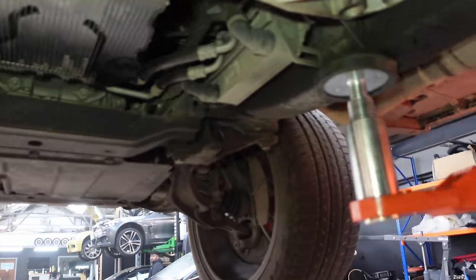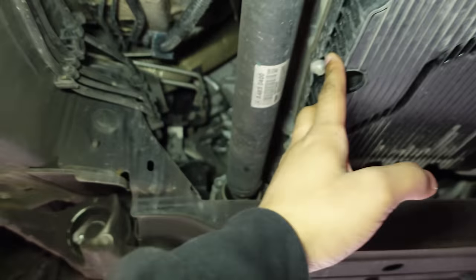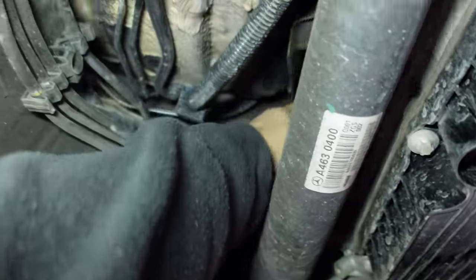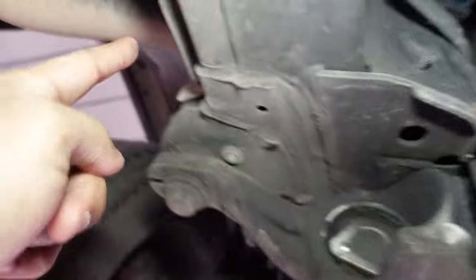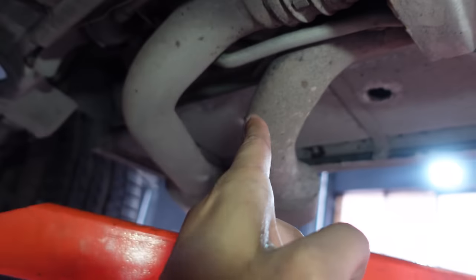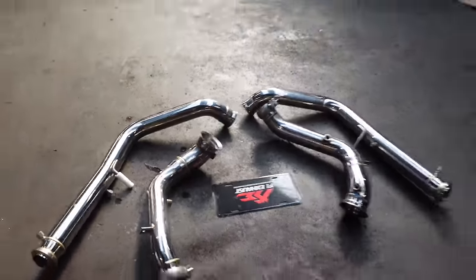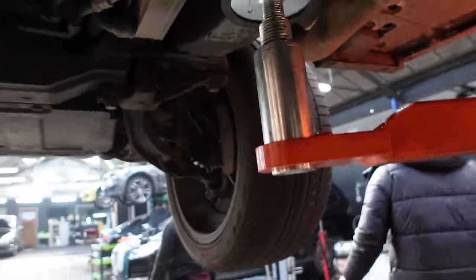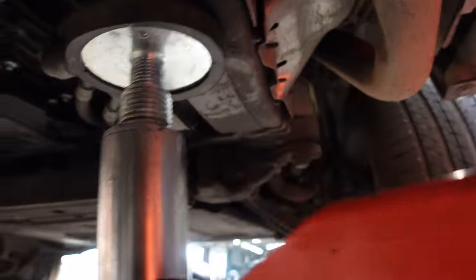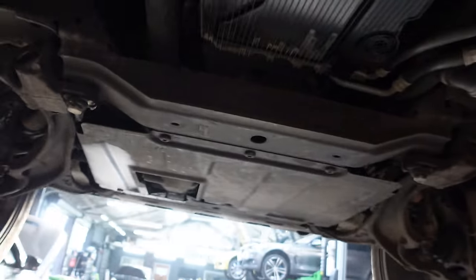So we're underneath the car now. On the E63 S engines, usually you take the gearbox off and remove the downpipes because the downpipes usually come straight down. But as you can see on this car, the pipe goes from there, all the way there, and across. Here's the DPF filter, cat-back, and exhaust system. What we're doing today is from here all the way up to the catalyst — taking this side off and that side off. That's four pipes being replaced. Even dropping the gearbox wouldn't help because the pipes go the wrong way.